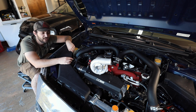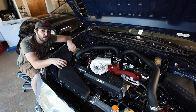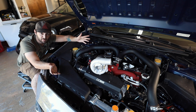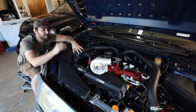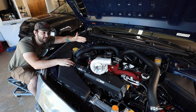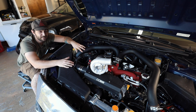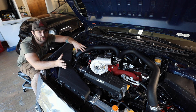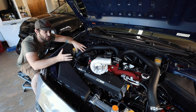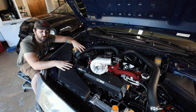If you're on a turbocharged or supercharged application, the turbocharger or supercharger compresses the air so you can get more of it into the engine — more fuel, more air, more power. Turbos run off exhaust gas which spins the impeller wheel, sucking in and compressing air. It then passes through an intercooler to cool it down to near ambient temperature before entering the engine. Superchargers work similarly, some with intercoolers and some without.